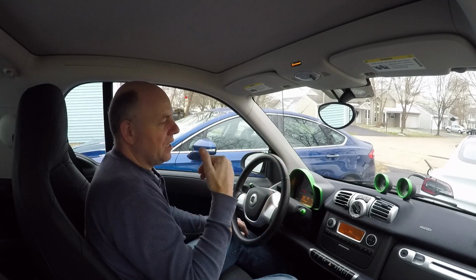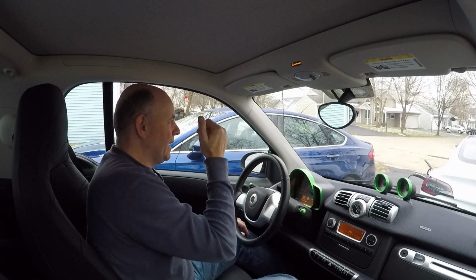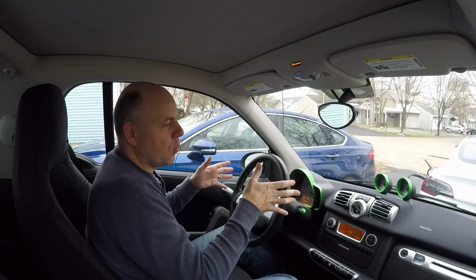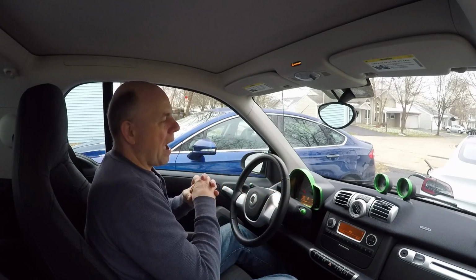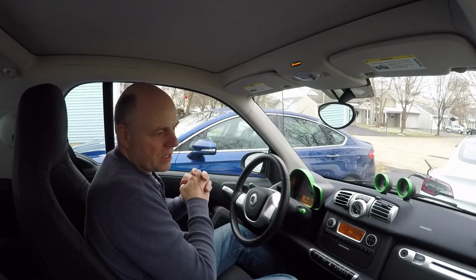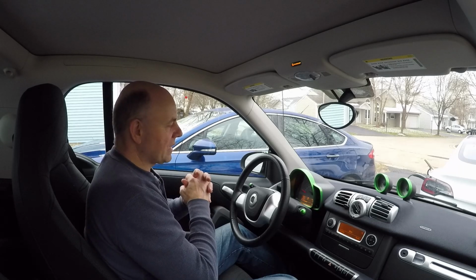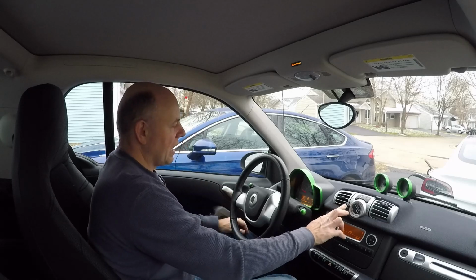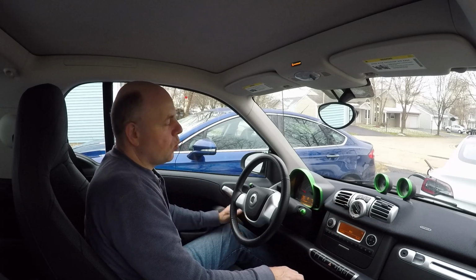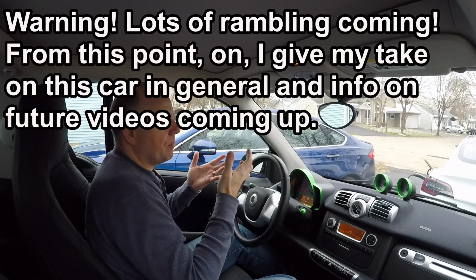So let's say you just want it at 68 degrees. You're already bundled up a little bit anyway, 65, 68 degrees. It's 30 degrees out Fahrenheit, so about 0 Celsius. And you just want to keep it warm enough in the car that you're not going to freeze. In an hour of driving, if I had to guess, you're probably going to use more like 15% of your range. So it's kind of a big deal. I mean, you definitely lose a lot. And so I'm excited to see how this plays out as we use this car through the winter. But I just want to give you guys a baseline of what you can see.